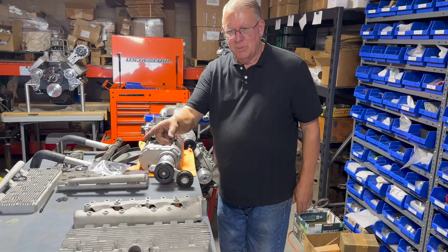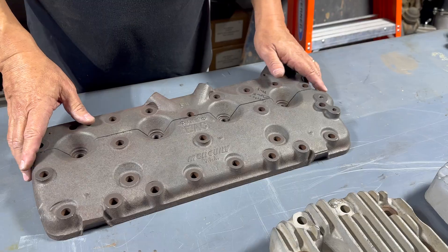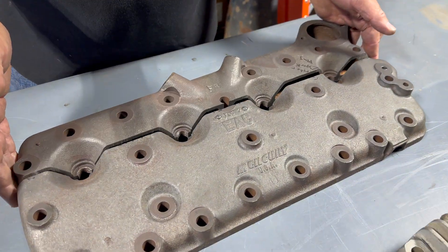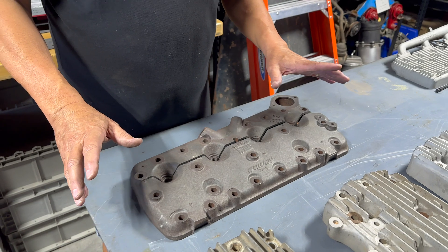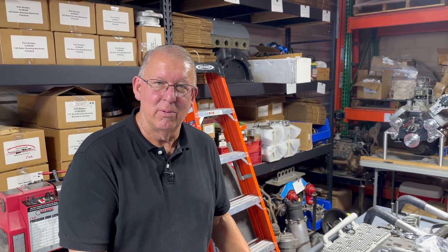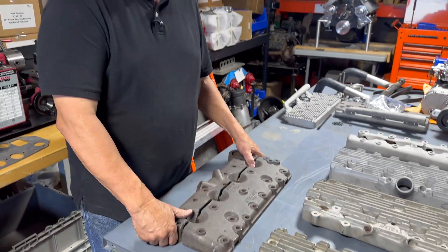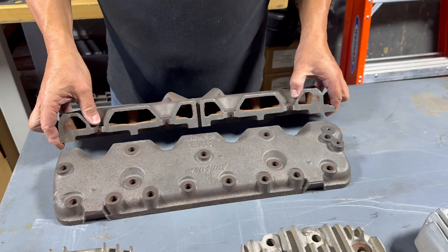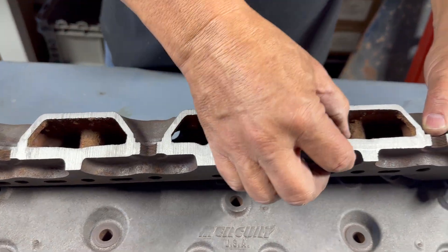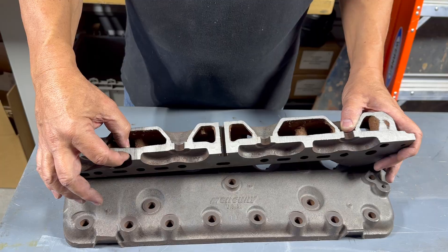Then we go to the other end of the manufacturing of flatheads. This is a Mercury head, and it's cast iron. What year do you think this would be? If we ran these numbers we'd figure it out — I think the EACs were around '52-ish, could be '53. But the earliest would probably be '49 and the latest '53 — we could run these numbers and find out. This is cast iron, so much stronger than aluminum of the same thickness. Pretty thick heads. Interesting to me is the Ford factory heads had a pretty good-sized chamber.